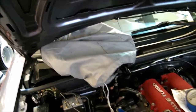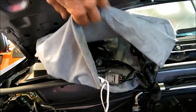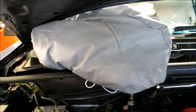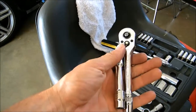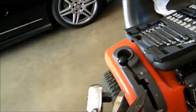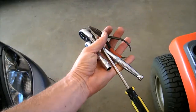After I removed all the electrical wiring from this bundle, I just stuffed it into this extra bag I had laying around — it's like a car cover bag I'm not really using. I just stuffed all the electrical wiring inside there to get it out of the way and so it's not damaged. The tools I used were a 10mm wrench or a 10mm socket, and a screwdriver. I also used this trim removal tool to undo some of the connectors that held the wires down.